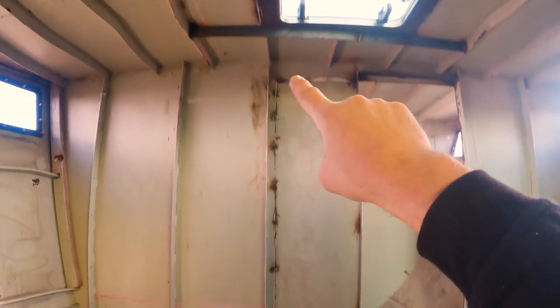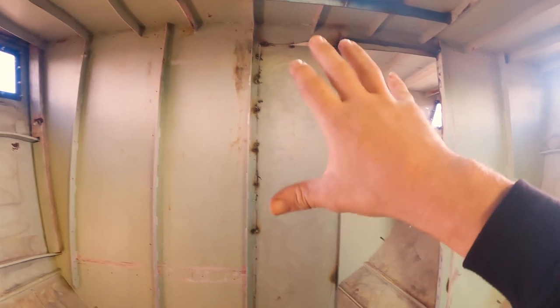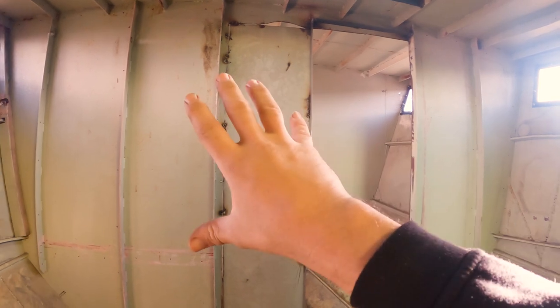So I might just take this whole panel back out. And when you get down here, some massive gaps. So what I'll do is take that whole panel out again. I'll straighten both of those cuts up so that when it goes back in there, it's got a nice butt joint to weld. But I'll remove that 100mm off of this piece, which moves that whole piece, the 100mm